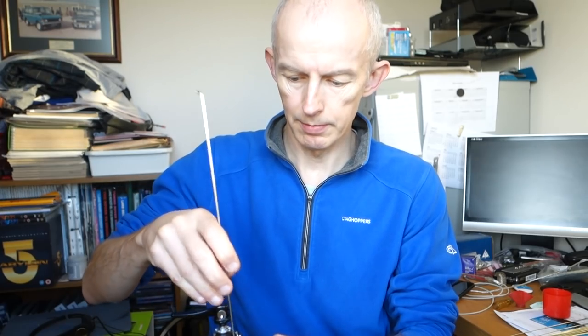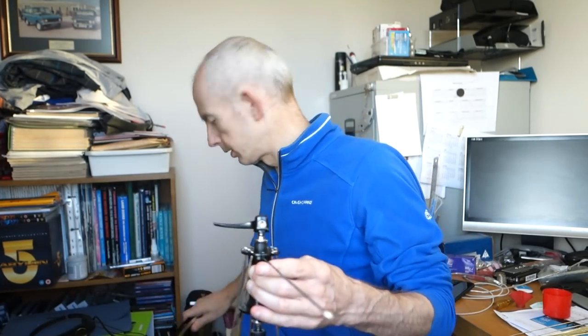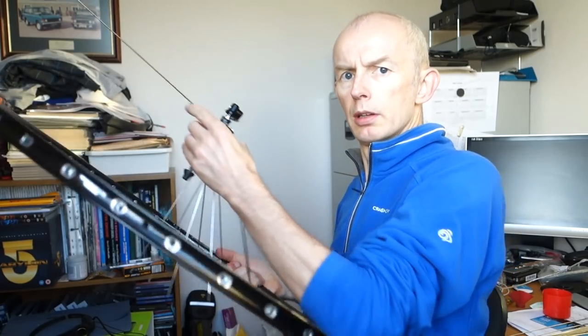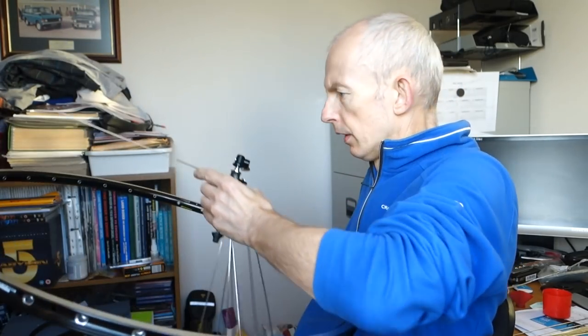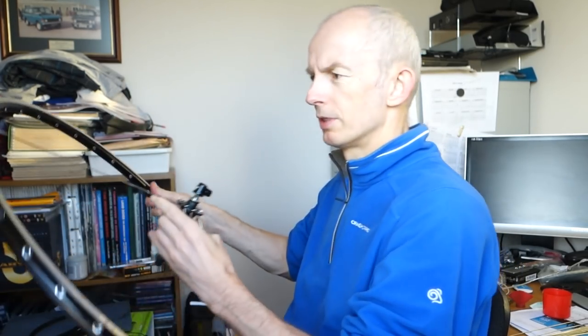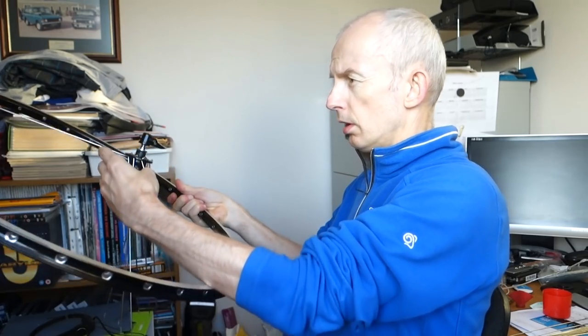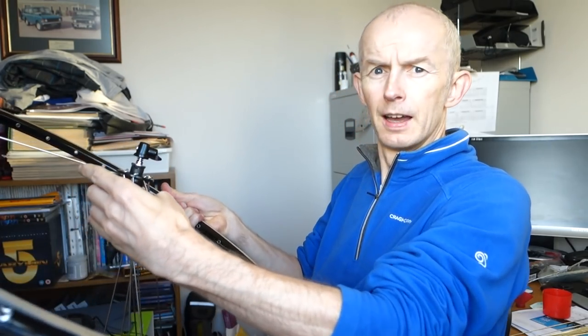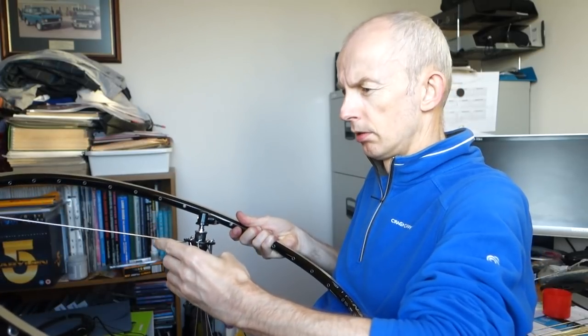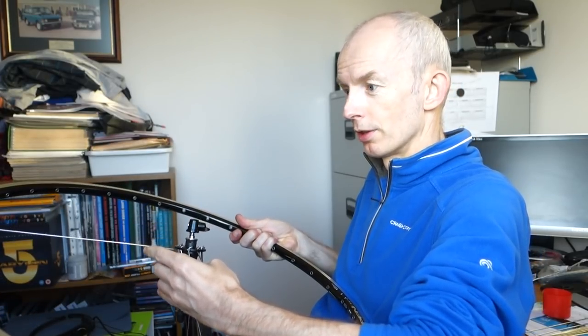And then I'm going to get my rim, and then we're going to find the valve hole again, which is here. And I'm going to put it away from me, like this. And find my valve hole, because now I've moved it, I've lost it. And because we counted left, we're going to go to the eyelet in the rim that's to the left of the valve hole, which happens to be up as well, so that's correct.